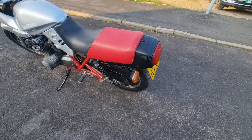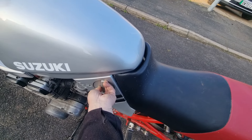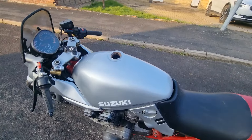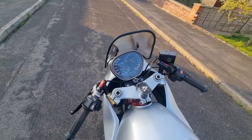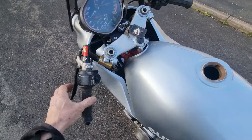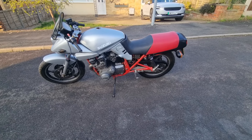Now we know this has been faffed about with. It's a full project — the brakes are not working, which is a shame because they've got this lovely anti-dive setup set into the brakes, which is a bit impressive. Obviously people have been in there before because it's got different bolts and things. Someone's tried to set the carburetors up — all the screws are missing there because they've been playing at balancing. It seems to have a Piranha ignition box.